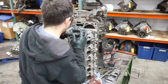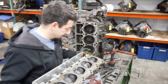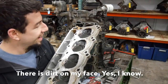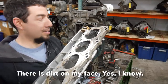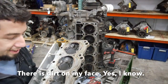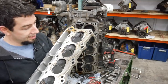Moment of truth. It's a Chrysler, and Chryslers do what Chryslers do — they dropped a valve seat. I wish I could say I was surprised, but I'm not. I kind of expected this, but at the same time, a Dodge Viper should be the best. If you have the best machining tolerances and the best parts, this should never happen. If this is the best that mid-2000s Chrysler is, that's not good. Whether it's a 2.7, 3.7, 4.7, 5.7, 6.1, 6.4 — they can drop a valve seat, and apparently also a Dodge Viper.